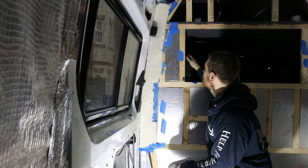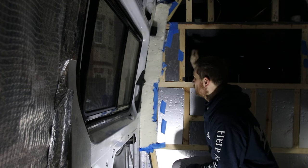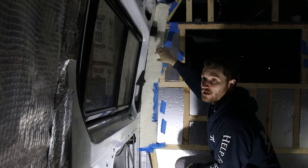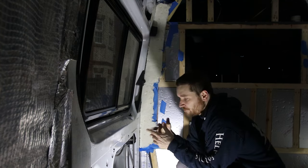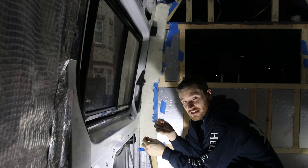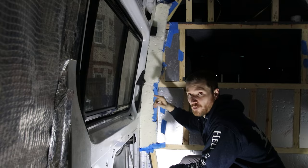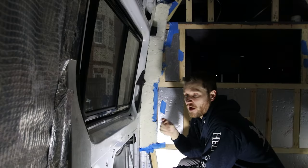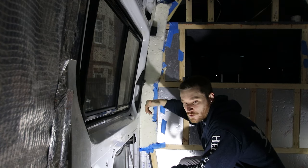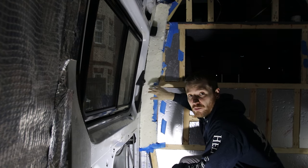So the idea of all this tape and cellophane was so that I could mould out the shape, fill the space with foam, and it would expand and fill out into the space I needed. Because the expanding foam doesn't stick to cling film, the same way I was able to peel off the top surface, I'd be able to peel off the back end, because it wouldn't have stuck to the bulkhead, the van body, or any of the shelf carpeting.